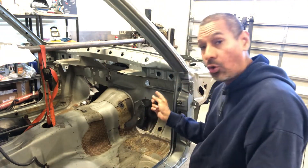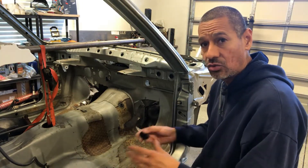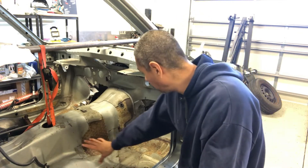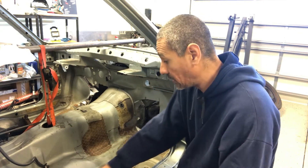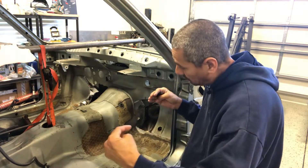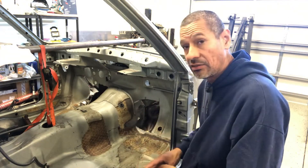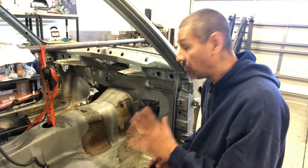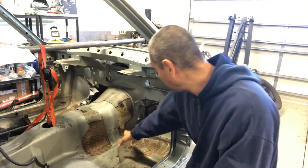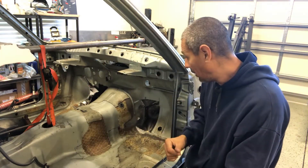My repair job technically goes in the trash. The reason why I had to cut that area out was for the headers. This is the first time we've ever done this swap, and it's mainly been a lot of Googling and trying to get information on what's been done in the past. We were looking at going into here on the header side — I was thinking I could still patch these up and be okay. But by the time we started getting the motor in and trying to get it to its resting home, I started realizing I've got to cut more than we initially planned. I still have this whole rusted area — I left it behind because I already knew that's coming out, so I'm not going to bother fixing it.